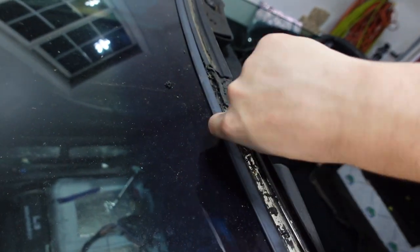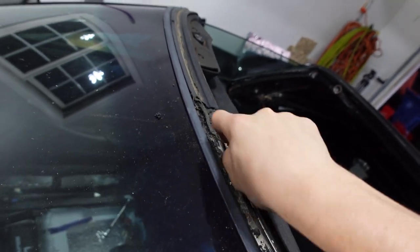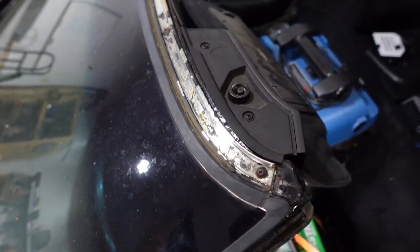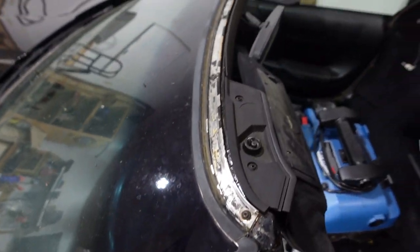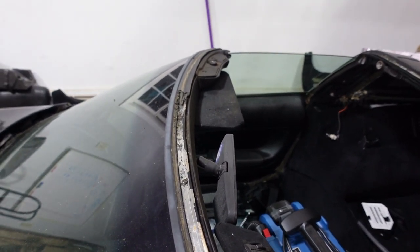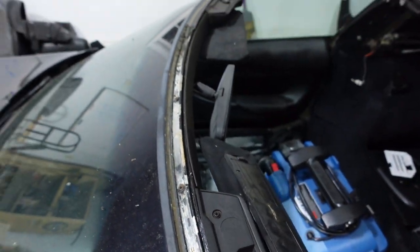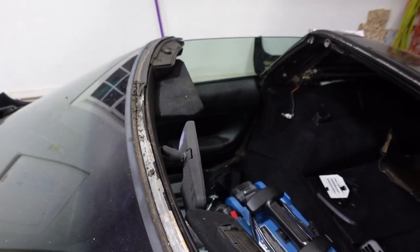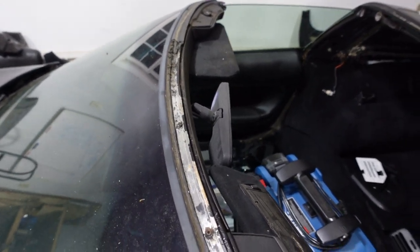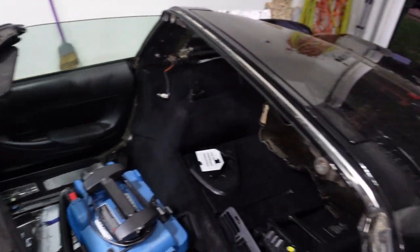It's definitely tiring — a lot of work. I did one removal last night and I'm doing one tonight. We'll get the whole thing torn out and then start putting the new one in as soon as my weatherstrip adhesive comes. I don't think I'm going to put a lot because these were a pain to take off, and I don't think it needs a lot since it's tucked in the groove. So hopefully just a little squeeze in between and we should have enough weatherstrip adhesive. That's going to be my method.